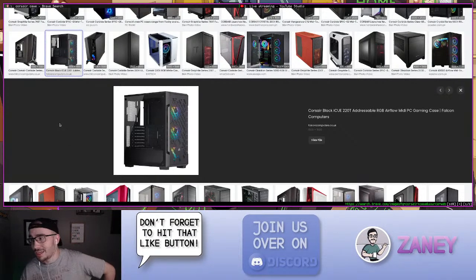Now I will say one thing, because I did switch the case and everything, and this one's got much better airflow. There's five 120mm fans in here compared to one 190mm exhaust in the other one. And technically I did have two fans on the water cooling in the sleeper PC, but there was no fresh intake for it. Because there's so much better airflow in this thing, I just have this 3800X running at stock speeds, but I could overclock this quite a bit. My thermal headroom is a lot. I'm telling y'all, I got lucky on the CPU. It's a real nice chip.